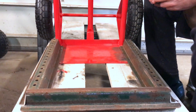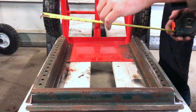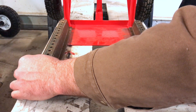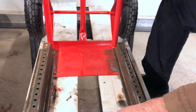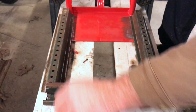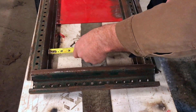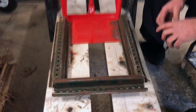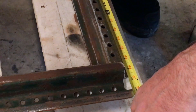I'll take a tape measure to double check. I have about 15 and a quarter inches to the outside of my tubing on both sides, and our end piece is also 15 and a quarter — we're looking good. It's ready to be tack welded in. Then I'll add one more brace across here, about 12 and a half inches, so that when you put your gas tank in there it has a little more support. My overall structure length is about 21 inches.